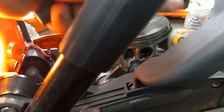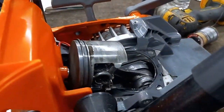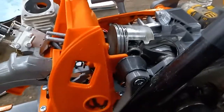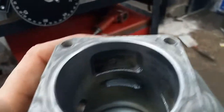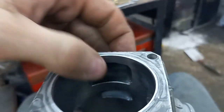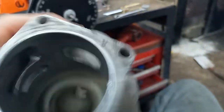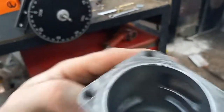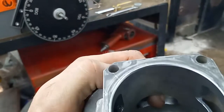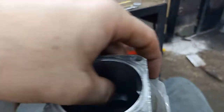It's got some flash and it needs to get cleaned up, but other than that I'm kind of liking what I'm seeing. I'm probably not going to change the numbers much — with that blowdown it has, I'll probably raise them a little bit, drop these, maybe widen them a little. I'm not going to change the intake timing, and the exhaust timing I'll change just a smidgen by polishing it up.